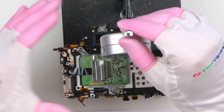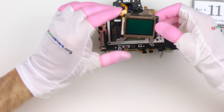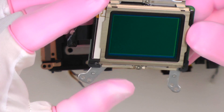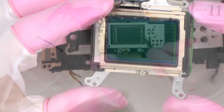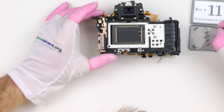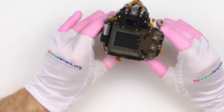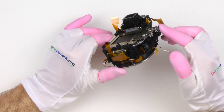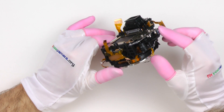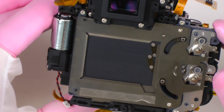I'll make a video someday about this measurement and exactly the tools you need. I have my measurements on a piece of paper — I double checked and I'm sure they are correct, so now I can remove the sensor without worrying about anything. This is how it looks like when removed from a camera, and here you can see the springs. Let's move on and remove the whole mirror box. The shutter looks quite solid — it's not a 5D Mark III and definitely not Canon 1DX type, but still it looks pretty good. I'll show you comparisons soon.